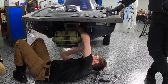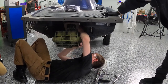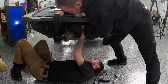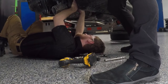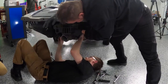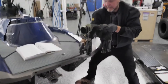These things definitely live a hard life. There's a chance I could have left the reverse bucket on, but I want the ease of access to everything else we have to touch today — I'd rather just spend the time now to pull it. The reverse bucket is the plastic shroud that drops down behind the jet pump nozzle and redirects water flow forward so the craft moves in reverse. This will really help us get access to these cables.